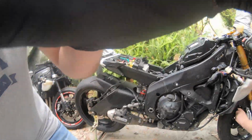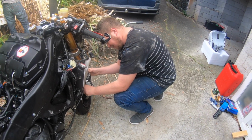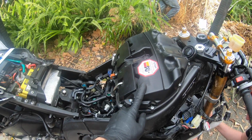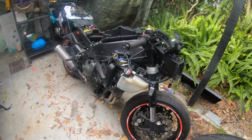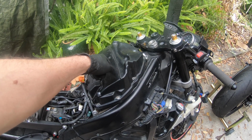We've removed all the tanks from both bikes, trying to see if it is cross compatible, and we've got our friend here, Nick, the pit crew guy, our mechanic. He's helping us today. So we've checked the air filter, it's good, injectors cleaned, spark plugs good, and the new bike, we've checked that we do have K&N filter here, which is a good sign.